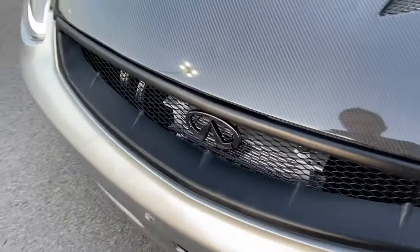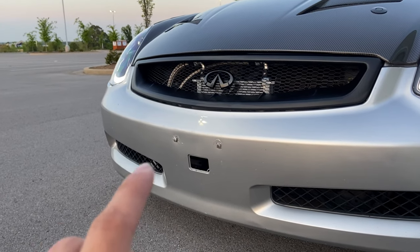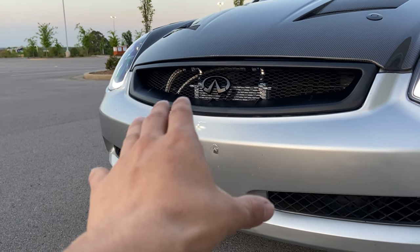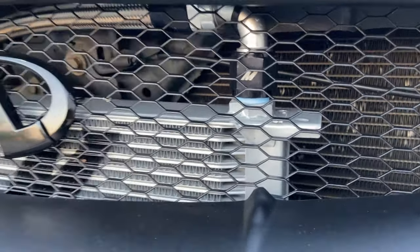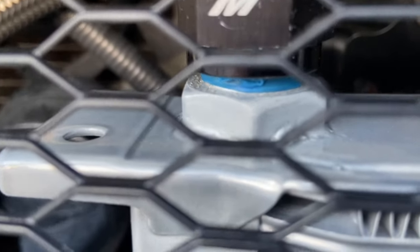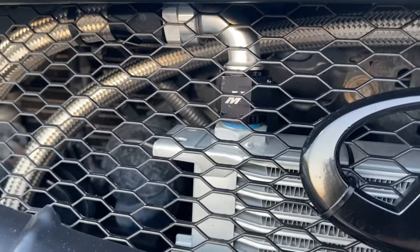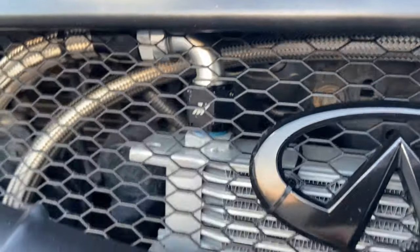For advice on oil changes: I would suggest you unthread these fittings and remove the old oil, because oil is still going to be inside the oil cooler and the lines. I've been running it for about a week and it's been good — the leak gods are on my side. You can tell if it's leaking if you see oil around the fitting — the threading tape is still blue. This one is slightly leaking, not a lot, but there's definitely oil around it, so I might have to go back and check. When you thread these you want to be careful — hold it up and wiggle it around so you know it's actually threading with your finger.